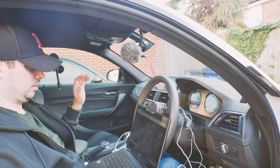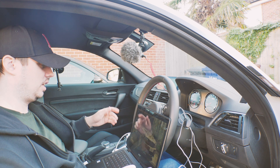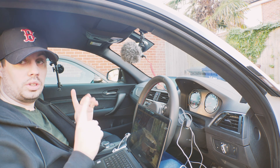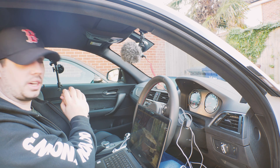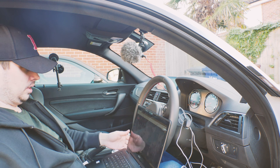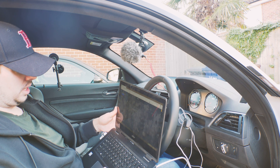First, turn the car on. The software that runs in the background tells you if it's detected your car. At the moment it's saying 'not connected.' What I normally do when this happens — and it happens a lot unfortunately — is disconnect the USB, go back in, and then it will check again. It's important to note that on most cars you need a booster pack for the battery. I go to Vehicle and it's saying OBD is disconnected. I click 'Identify Vehicle' — that should sort it. Yep, right.